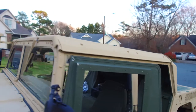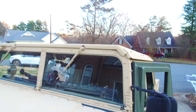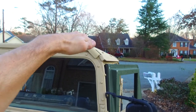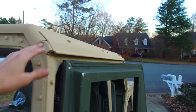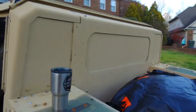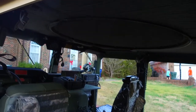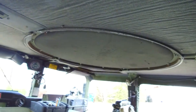The roof looks a little different than what we've seen on prior trucks. This is aluminum where the BattleWagon 2 had a steel roof — up on the edge it was a nice gentle curve coming down, but this is flat and then comes down at an angle with an extra little piece to deflect water over the edge of the doors. That's typical of the 11 series trucks. The C-pillar area in the back is cast aluminum and we have a solid rear wall. Inside, some of the turret support stuff is built into the roof itself, and we've got a factory-installed plug up here — a turret delete, since we don't have a turret installed in this truck.